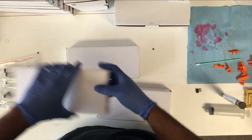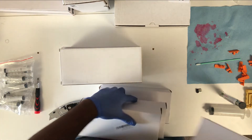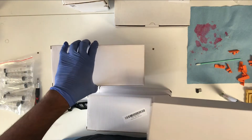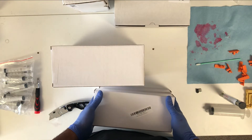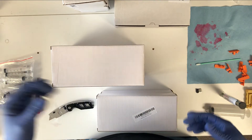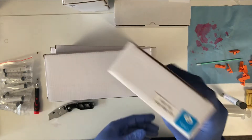Going from the bottom up: white replaces light magenta, then white replaces light black or LK, then magenta, then photo black. Remember, I'm skipping matte black because my printer defaults to photo black — I'll set that aside and just have an extra cart. If you haven't ordered yet, power on the printer and find out which channel it defaults to, so you know if you need a cleaning cart for that. Then continuing: light cyan, yellow, and finally cyan.